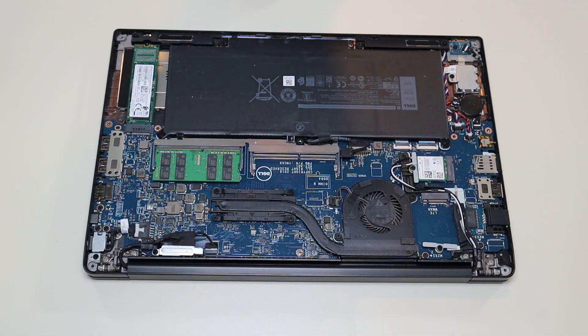And this is what you're looking at for the inside of your computer. As a side point, whenever I'm working on a computer in my shop, it's sitting on an anti-static pad. Either a pad or an anti-static bracelet go a long way to help you avoid damaging things in your computer when you're working on it.